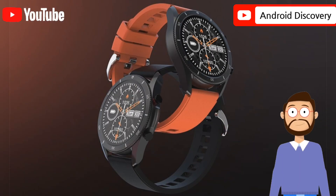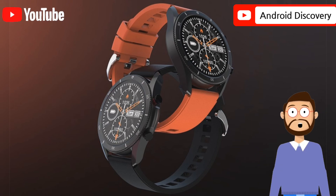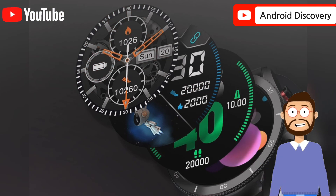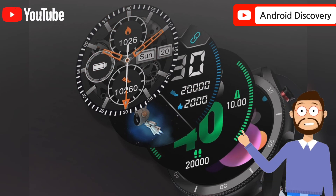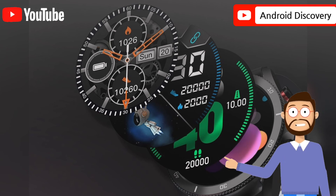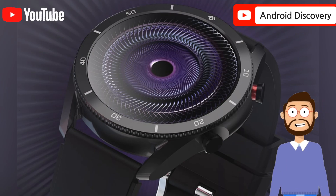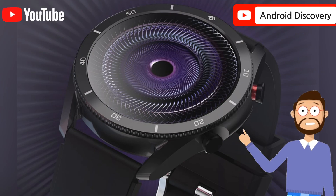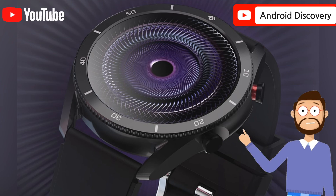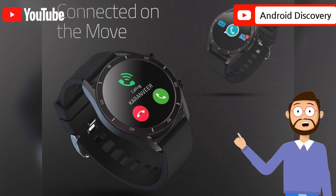The smartwatch uses LED lights and photodiodes to illuminate the blood vessel and monitor heart rate via the change in green light absorbed. Heart rate data is fine compared to other models, but the SpO2 or blood oxygen data always shows 96 or 97, while other smartwatches and oximeters show 99. The BP monitoring has the same issue since it uses the same green LED to derive the data.